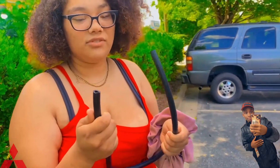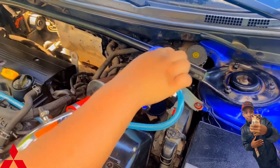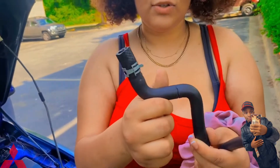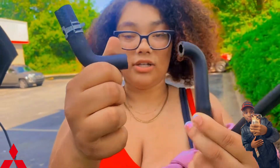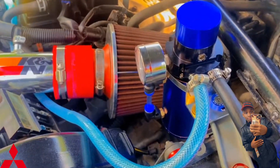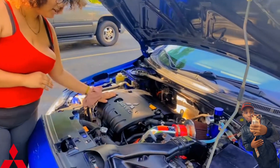Now we're going to start with the second tube. We're in a different setting because we had to go get it from the auto parts store — this was $3. Cut it for yourself. You want to unhook this and get it ready to go on the other side. This is the factory one that came with the car — you're going to split it in half, cut right here, and shove your auto parts piece into it and it'll fit. Run it through underneath, then connect it right there. When you're all done, go ahead and put your cover back on and your hoses will be sitting in place, and you're all good.